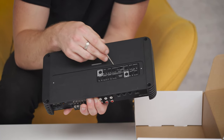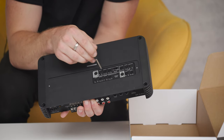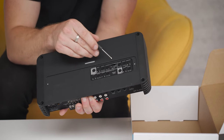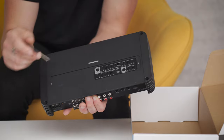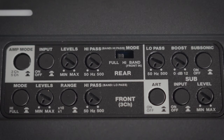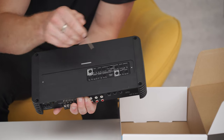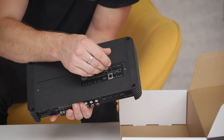Next to that are the rear adjustments, labeled rear, front, and sub. For the rear you have input on or off, levels, high-pass filter adjustment (the screwdriver is handy here), and the high-pass mode — full range, high pass, or band. On the front you have mode, level, range (clicked in and out in ten increments), and high-pass adjustment. On the sub side we have the low-pass filter, bass boost, subsonic filter, ART input, and levels.